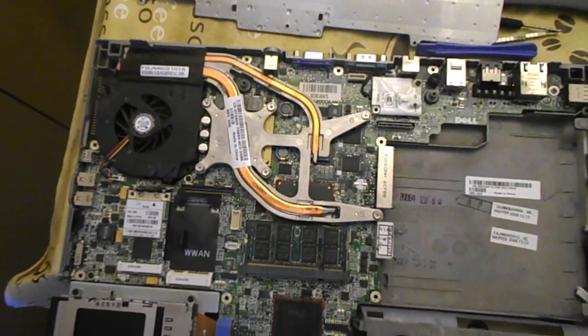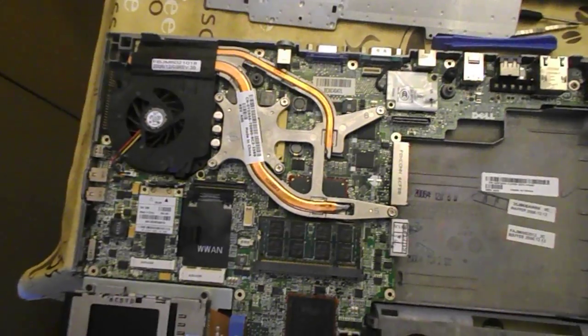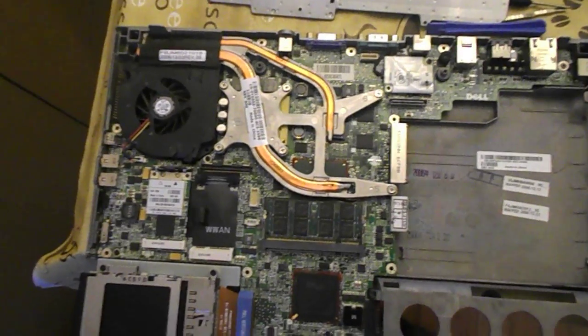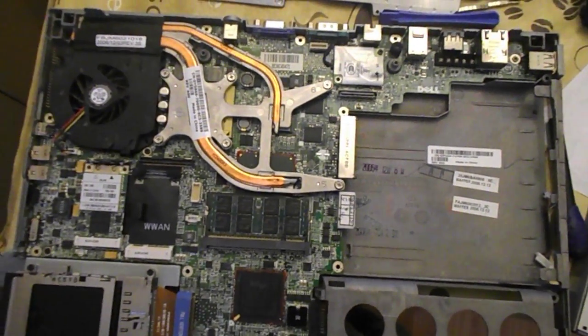You do the load defaults and escape and save in the BIOS, then restart the computer. It will be a long boot until the BIOS gets rewritten. And then you will get the fan spinning and everything will be okay.